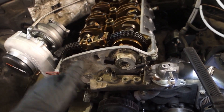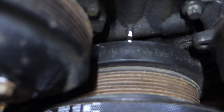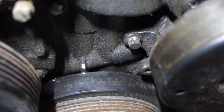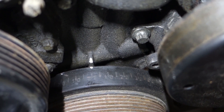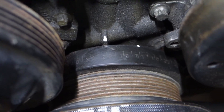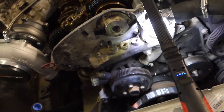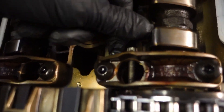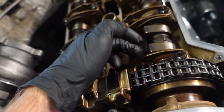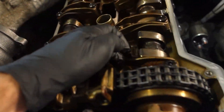We can also check and set timing by the Mercedes manual method. You need to turn the crankshaft clockwise — same critical direction rule applies — and set it to 20 degrees, turning only clockwise. It's on 20 degrees. It's not critical if it's off by a few degrees because most likely you'll need to turn it more later. First we check intake timing. We try to insert the timing pin but it's not inserting because it's not aligned. While trying to insert it, we turn the crankshaft clockwise until it goes in. It's in.